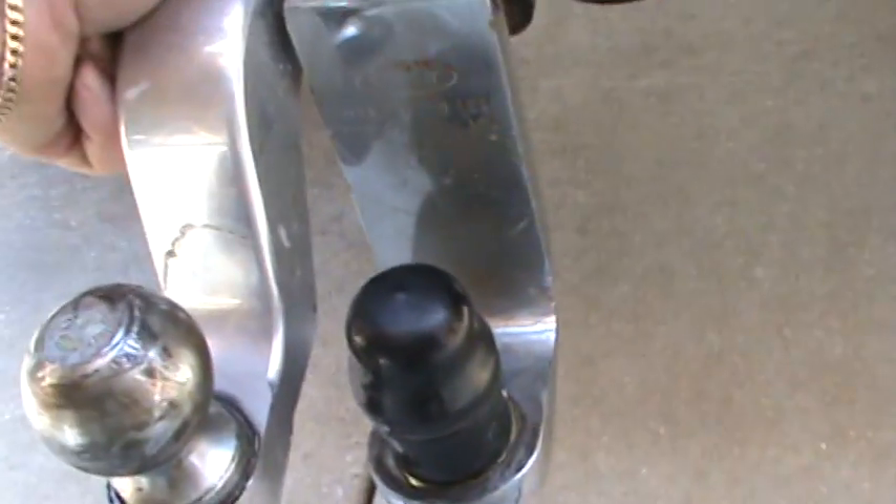When I haul the boat I use this aluminum pin. It's rated for I think five thousand or ten thousand pounds with a two and five sixteenths ball. That is two inches higher than the regular drop pin — that's for pulling a big trailer.